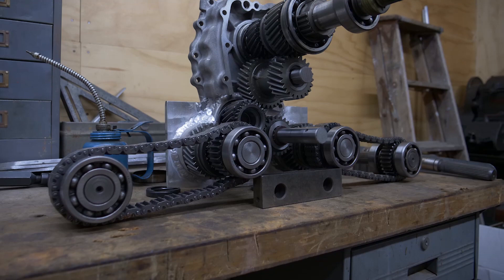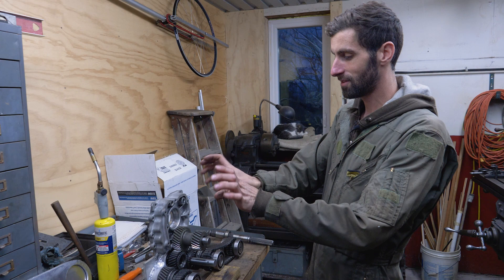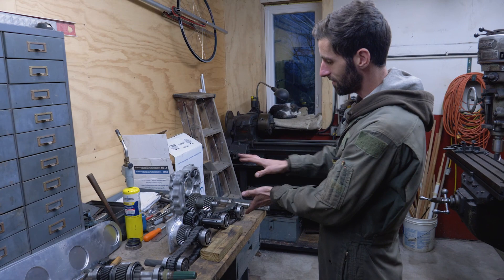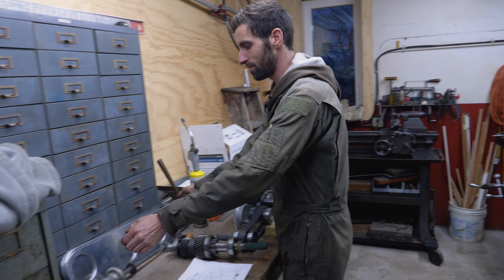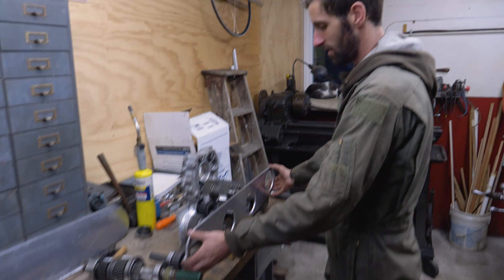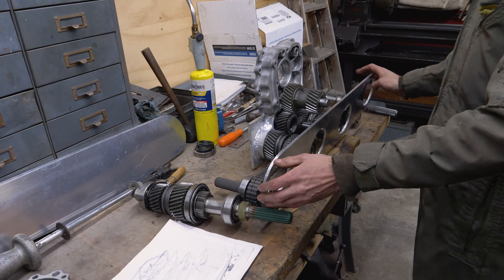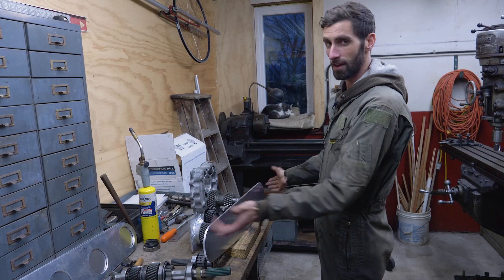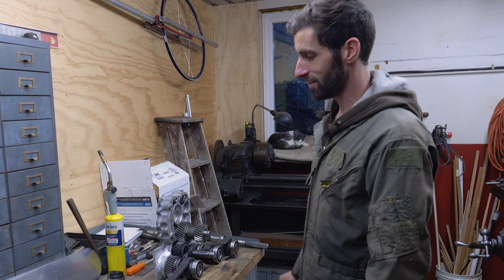You have four gears now, because you can't just have two — they would go the same way. You have to have a control gear. I'm building a case — I can use the top of the original case, but from here down is all new. These are quarter-inch plate aluminum. This one is going to be in the middle here, and then this plate will go on the end. Unfortunately we still have to have the transfer case because it's three pieces — it has to all bolt together. That's where the challenge has been, because you have to be able to dismantle this thing if you have problems. That involves a lot of welding and cutting and drilling and tapping.